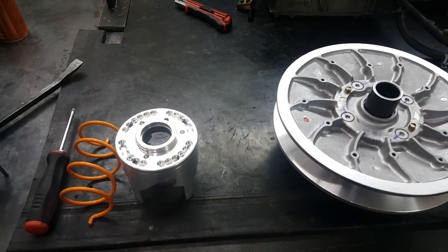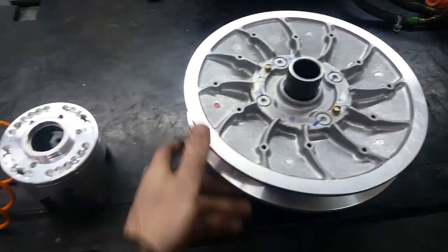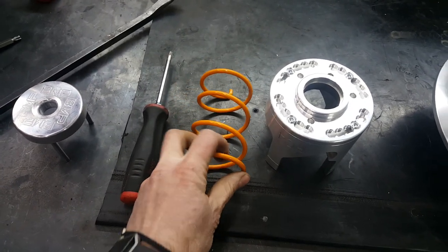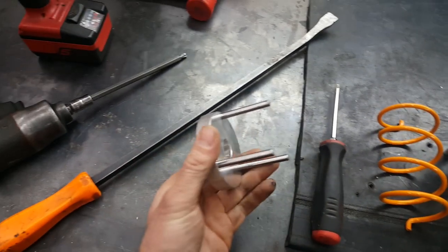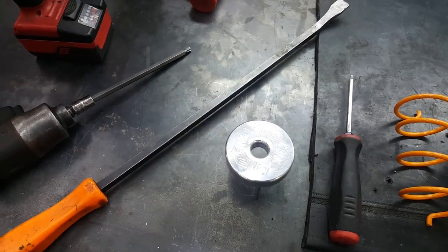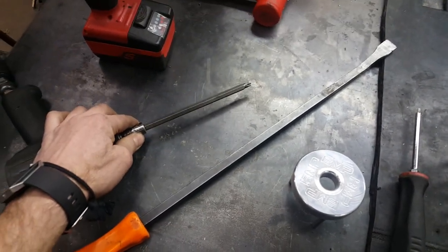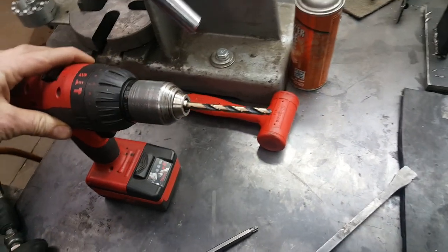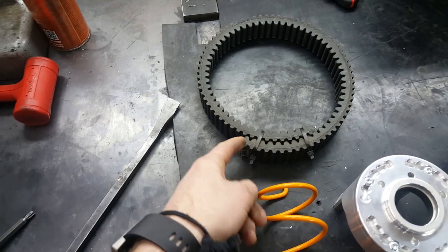Here's a quick overview of what you're going to need. First, get your secondary clutch off. You'll need your stock secondary clutch, your new helix from Bikeman, a torsion spring, a T25, a special tool from Bikeman — you'll see it on their website along with the clutching stuff — a pry bar (T40, preferably a quality one), a drill, and a quarter-inch drill bit.